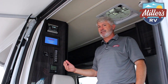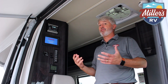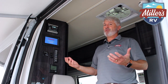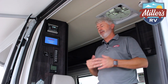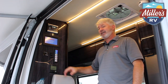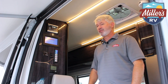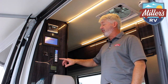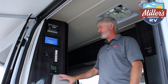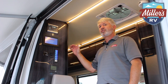First, the multiplex lighting system. 'Multiplex' basically means the wires are connected with a brain using fiber optic or Cat5 cables throughout the coach, so instead of individual wires to each light there's a wiring harness controlled by a brain — it's what most cars and all high-end coaches have, and Winnebago puts it even in their Class B. When I touch master light, the lights I had on come back on. Hit master off, they go off. If you're going out for a bit, hit master off; when you come back, hit master light and just the lights you had on come back. Hold down master light and all lights in the coach turn on. There's also a rear controller so you can turn lights on from different places.